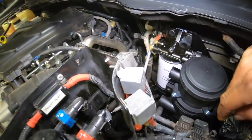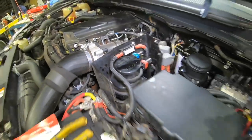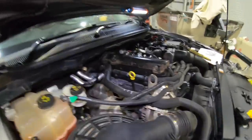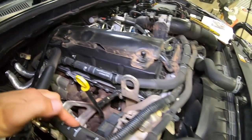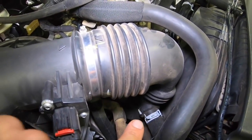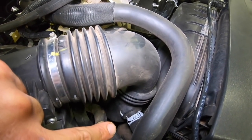Now we've just got to run those pre-made hoses from here, around the back of the engine, over to the crankcase. So I'll show you where it joins up. You'll see this one here. This is the standard one, right? So when I told you at the start, it just pumps the oily mist straight out of your engine, straight back in. Follow it. Here we go. Bang, straight into your intake. Not into your filter or anything. It just goes straight back in to there.